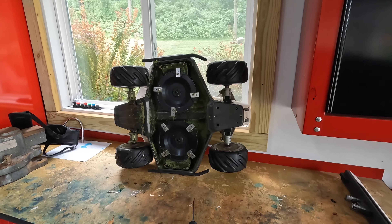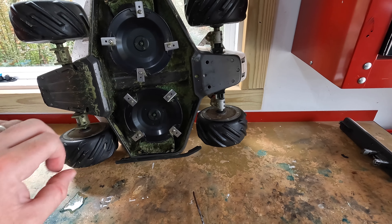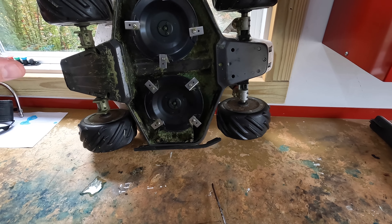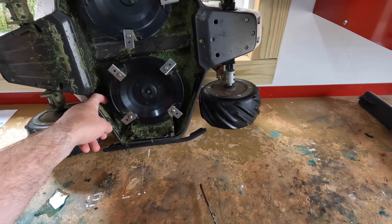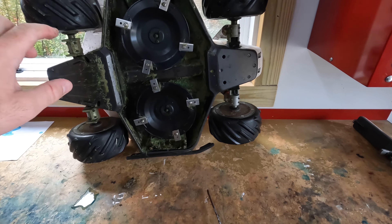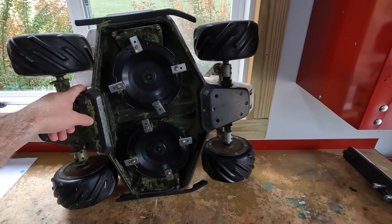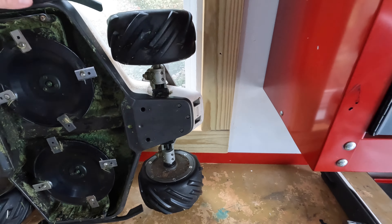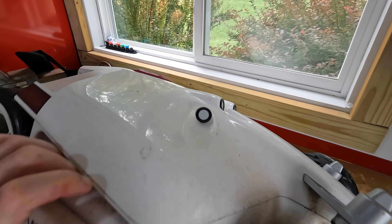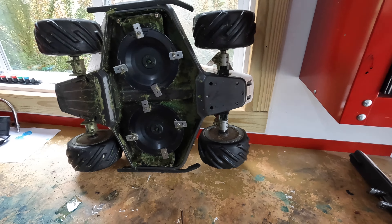First thing I noticed — and I've noticed this in the past with this particular Luba — there's some water here. When I've picked it up before, you can hear water sloshing around. It could be that water got somewhere on top and just needs to dry out. Hopefully it didn't fry anything. There's also some grass buildup here, but nothing bad. The cutting motors can overload and give an error, but the app would say 'cutter motor overload,' so I don't think that's what's going on. I think we have to get into the top, take the white cover off, and get at those sensors.